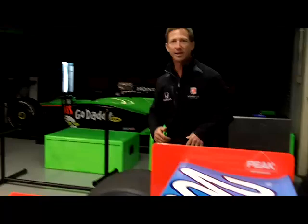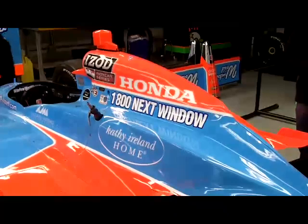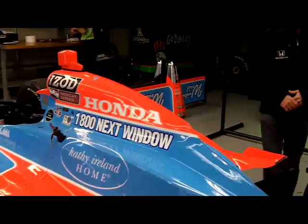Underneath is actually an underbody. The whole Indy cars for the last two generations, two decades, were actually ground effects, which means the whole car is actually like an airplane wing, only it's upside down. Instead of trying to lift it off the ground, it's actually trying to pull it down.